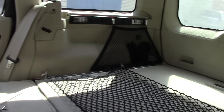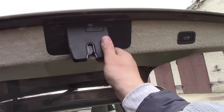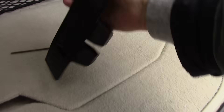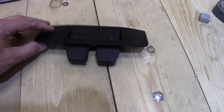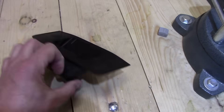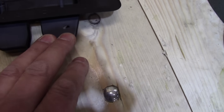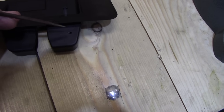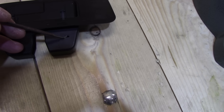Once you get inside, you're going to be working on the lock just over the gap. We're going to use the pick to puncture the plastic cover on the lock and move the little lever to release the tailgate and open it. The cover on the lock — you just pull on it and it comes off. On the back side, from the factory there is a small indentation where you're going to puncture it with the sharp tool to gain access to that little lever that will release the lock. You puncture it here and then just twist towards the right to release the lock.